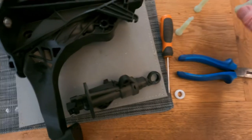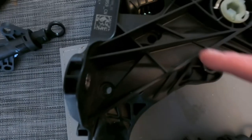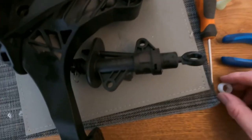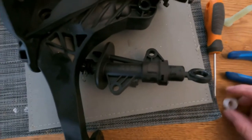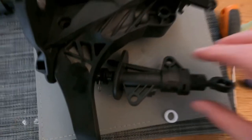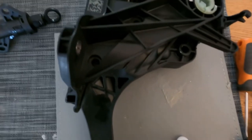I was right — you've got three white push-on bits, push them out and then the master cylinder comes out. There's just a white little bit that sits in there. I'll have to put the new one in there and push the plastic bits back up through, and that'll be the new one in.